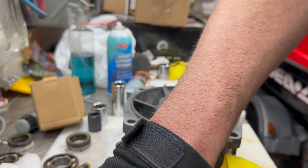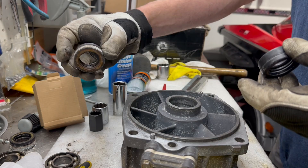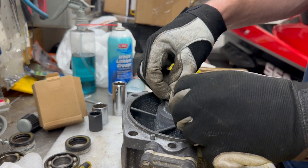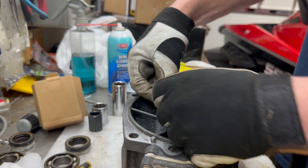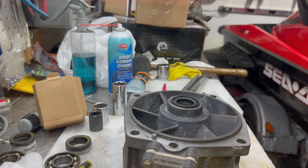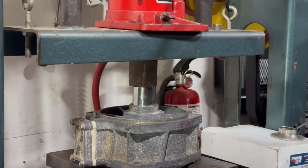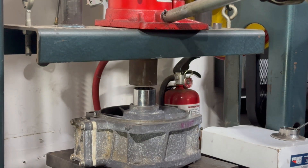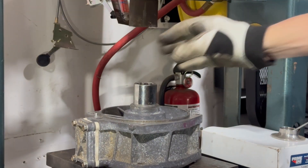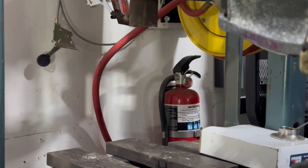Now that's done, we're going to put our two grease seals in. The cups face each other — actually the skinny seal goes in first. All right, seals are installed and we're ready for the shaft.